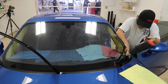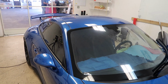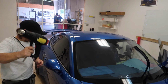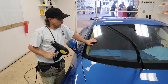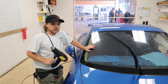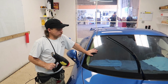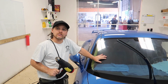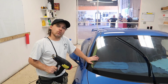And he's ready to do it. Now, is 70 less forgiving than 90? Like, do you have a bigger chance of making weird looking spots and stuff? Not really. The reason you consider it a little more difficult is the color. The 90 is virtually invisible. The only thing you'll see there is possibly distortion if you keep the layers. With this one, you can distort the actual color in it, and it doesn't necessarily have any dyes in it. But because it's a multi-layer, it will stand out more, like silicone.